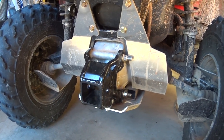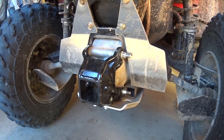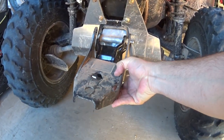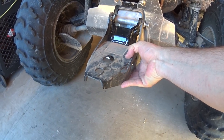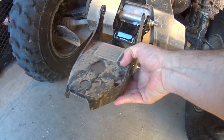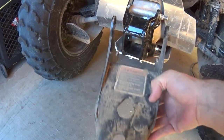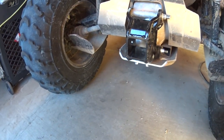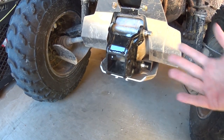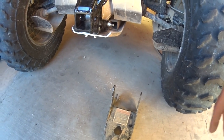So if you don't have a Can-Am Outlander, then this probably doesn't apply to you. I replaced my stock hitch. This is the stock hitch that was here just a little while ago, and it's made to put a ball in, but the ball is for one thing too low, and then when you release the coupler on the trailer it hits the bottom of this, so it's really of no good if you plan to actually tow a trailer.